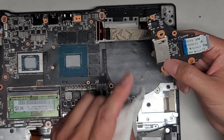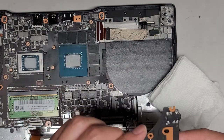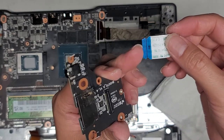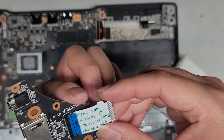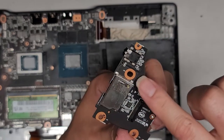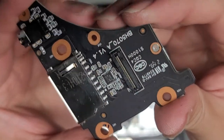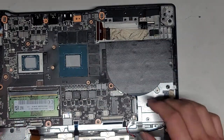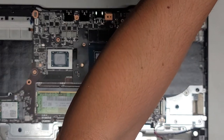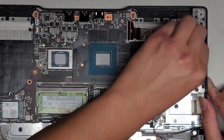We have this piece — make sure you get it back in the right place. We're going to also unlatch this and take this cable out. Make sure to keep in mind it says IO — that's because it goes to the input/output board. The other side should say MB for motherboard. Basically I'm going to use some warm water, run it over this, scrub it with a toothbrush, then dry it off really well with my electric air blower — not a hairdryer — to get that salt water residue out. It's very important to remove the salt water residue; if you leave it, it's just going to corrode and rust.